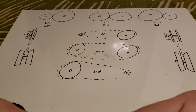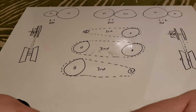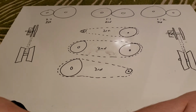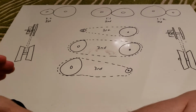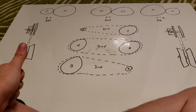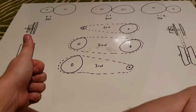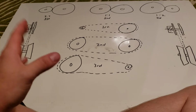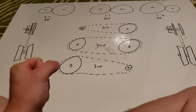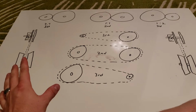But if you have a golf cart that you want to put on bigger tires with two people and you know you're going to be going up and down hills and putting it under load, at that point, you want to put the spring in, and you absolutely want to put the spring in if you are putting on bigger tires and a rear passenger seat, which means an additional 100 pounds and the weight of the riders. You're going to want the torque spring so that it can manage the gearing a lot better. That's a very simple way of putting it.